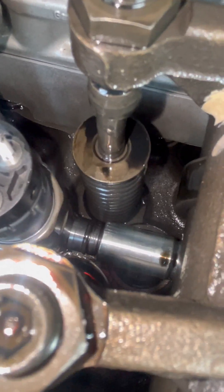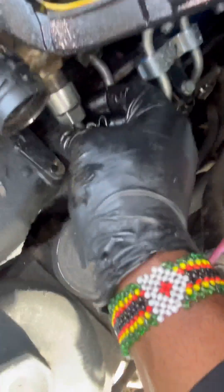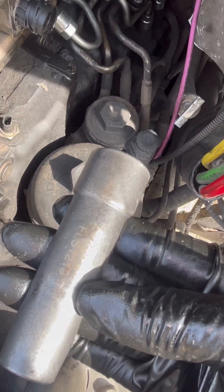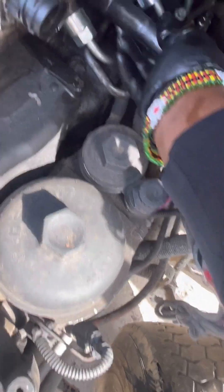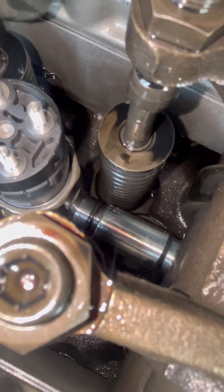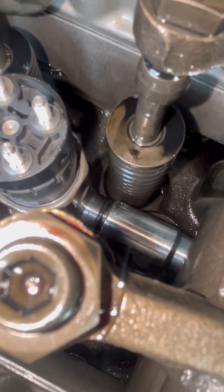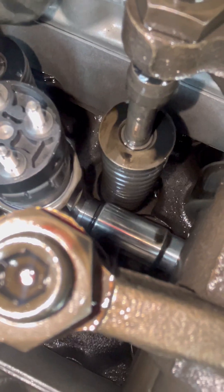This is the part where you put your injector fuel line back in. I like to secure it just a little bit first to stop it from moving. There's a special tool you use for this — the part number is fading but I'll try to add it. You stick it in and that's how you're able to turn it. I'm just twisting by hand right now and you can see it's getting on there. It's the same process when you're taking it off.